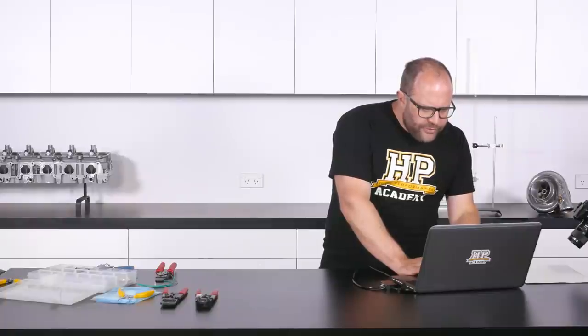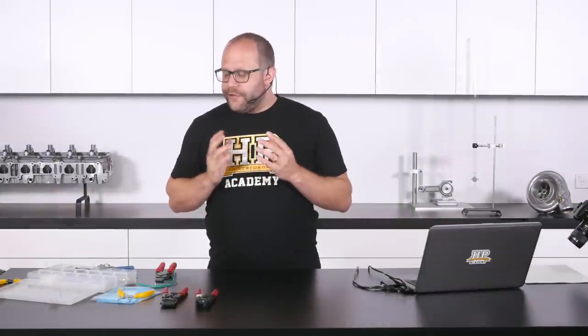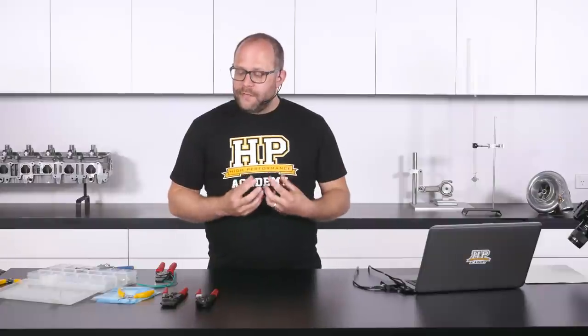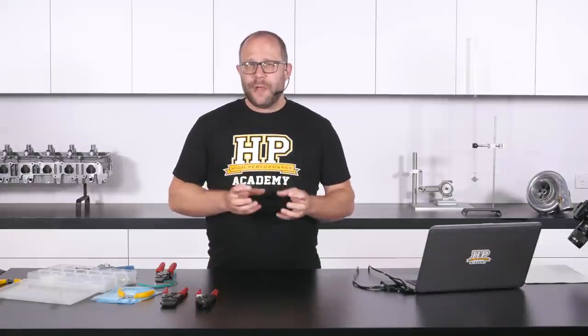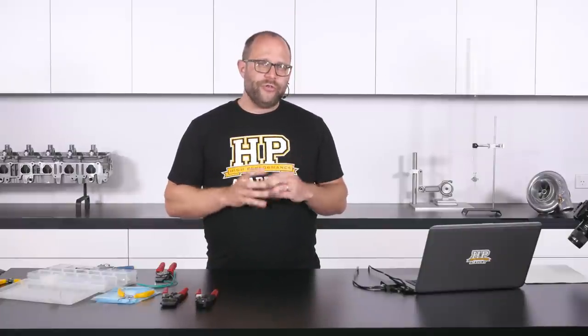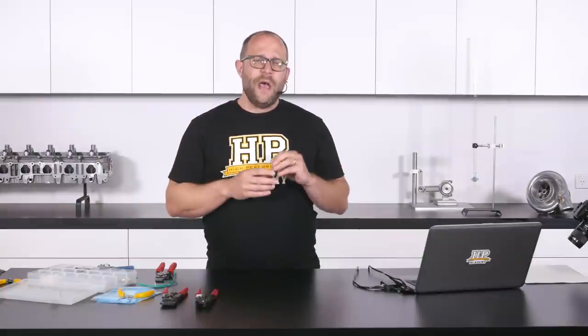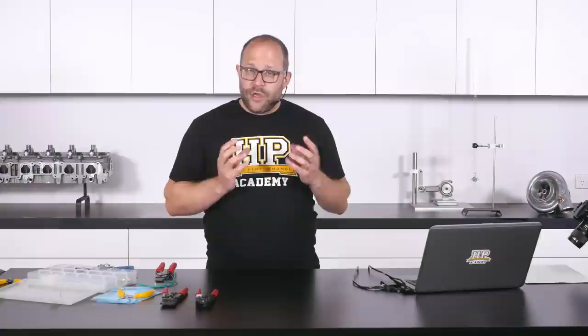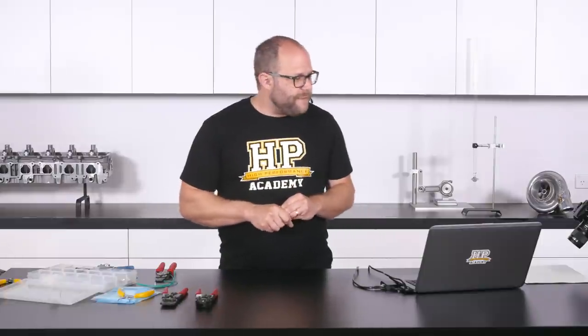Pedro has asked about important differences between closed and open barrel splices. From my perspective, I've not seen a difference in electrical performance — conductivity — and I've not actually seen a difference in reliability either. But that traceability aspect is absolutely crucial at a professional motorsport level. You need to attach that to your documentation because if something goes wrong and gets traced back to a splice joint and that costs a race day, that could be tens of thousands of dollars down the drain and they're going to want an explanation — so you need that traceability through your documentation.